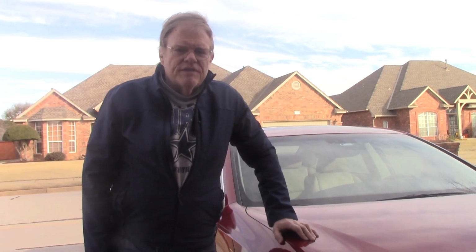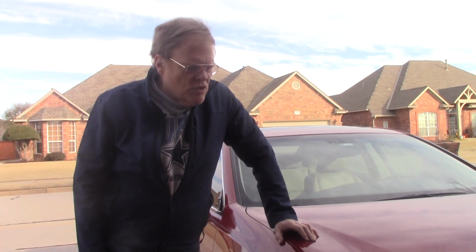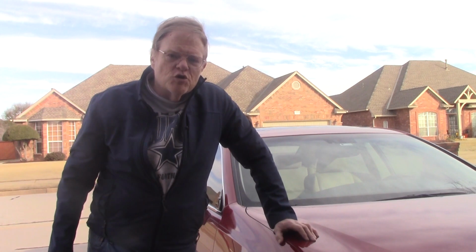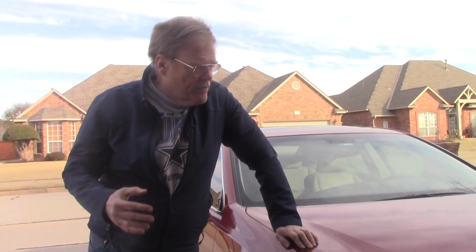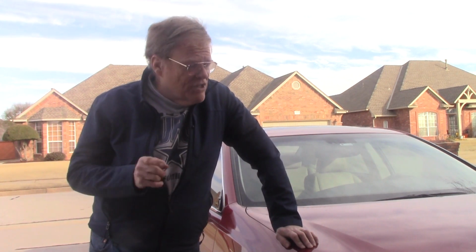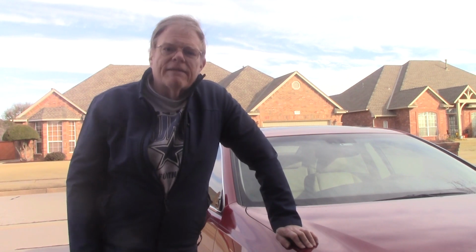And that's what we're going to do today on this Lexus ES350. This is a 2015 model, and we're just going to swap front to back. That's according to the manufacturer specifications. You just do a front to back wheel swap. Actually, we're one maintenance interval behind the regular schedule. The maintenance manual suggests that you should do a tire rotation on this vehicle every 5,000 miles. And I just finished the second oil change. We did the first oil change in a video back last summer.